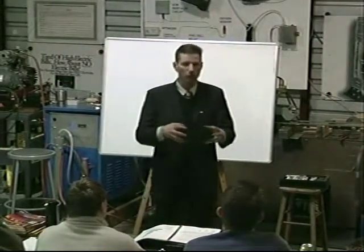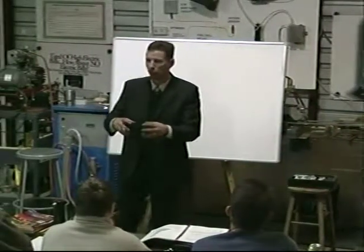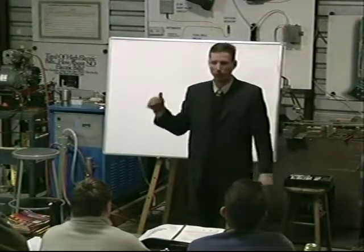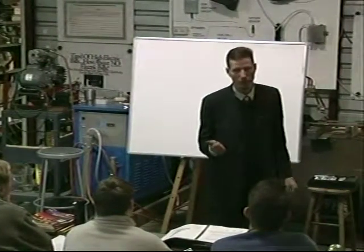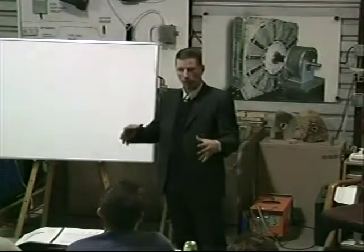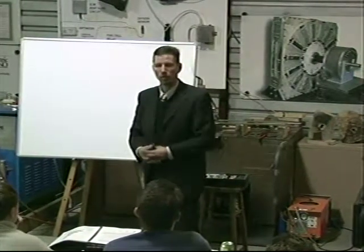The more engine coolant thermal energy, heat that you can get into the fuel, the better. If you want to take heater hose and literally wrap it around that aluminum housing and then pack fiberglass insulation around there and duct tape it, make it look ugly as can be, but get a lot of that thermal energy into the fuel. Yeah, but let's limit it to coolant temperatures, because all of the injectors on the market are going to be more than capable of handling the 230 to 240 degrees maximum coolant temperature of an engine. The fuel pump is going to be capable of handling that kind of temperature. And as long as you can keep the tank pressures to a reasonable level where it doesn't just explode from internal pressure, not even with the flame, then anything coolant temperature is fine.